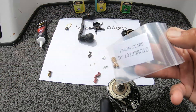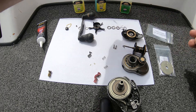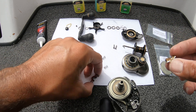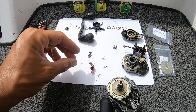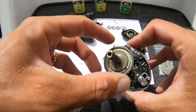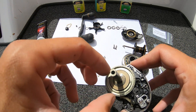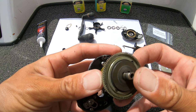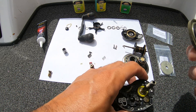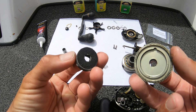Put the new pinion gear here. Slide it in. New pinion gear. Take off the sleeve. I'm going to slide out the whole drive gear. I'll take all these washers off together and just keep them together.